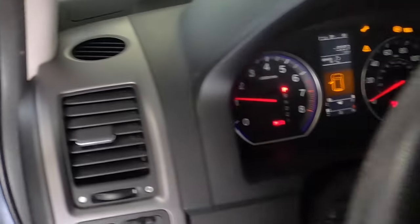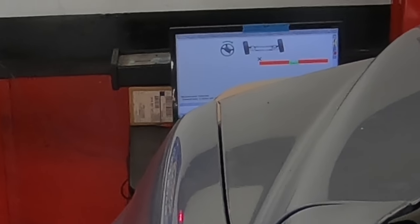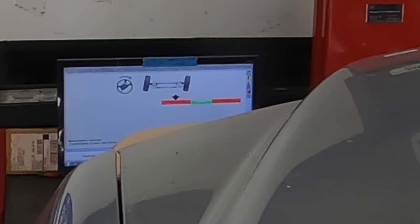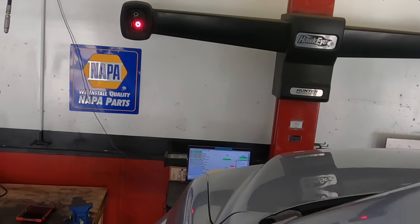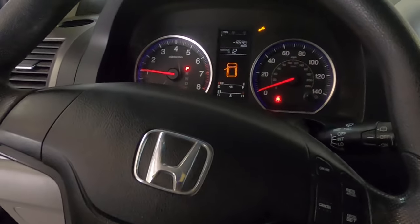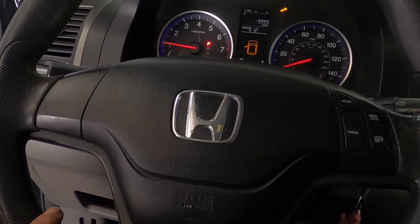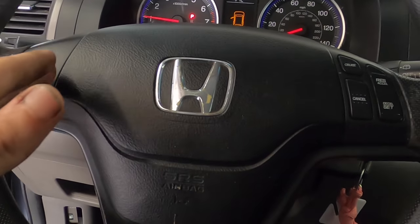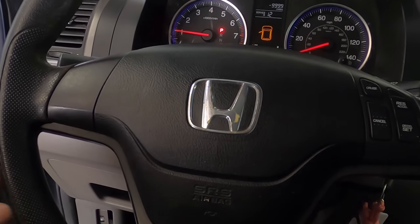I'll start the engine and use power steering to make the turn for the caster sweep. Going back to the right now past the center line — there's green, it took its picture — and moving back to center. We've got our measurements. Back in the car, I'm going to visually orient the steering wheel so it's centered by backing away and finding a plane to compare to, then give it a shake to work out any play in the steering shaft or suspension. Everything seems settled and we can begin the procedure.